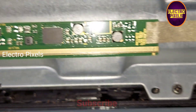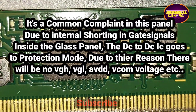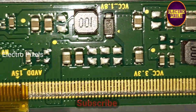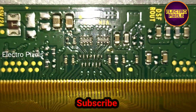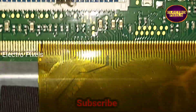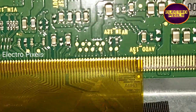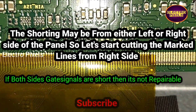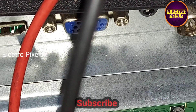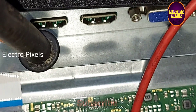While opening the back cover of the Elto TV, I found that the TV panel is a single curve 32-inch China panel with an SM4186 DC2DC IC. As we discussed earlier in our previous video, here also the DC2DC IC named SM4186 panel IC goes to protection mode due to internal shorting inside the panel. The gate signals are short inside the panel because of that internal shorting, so the DC2DC IC goes to protection mode.